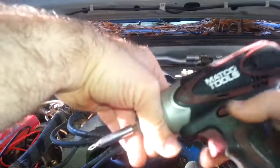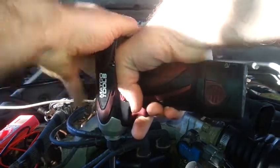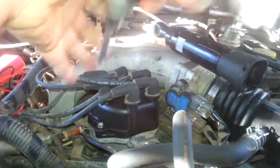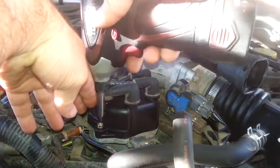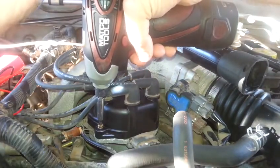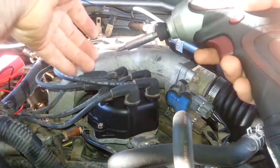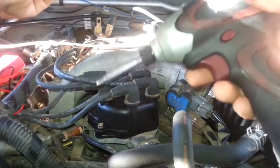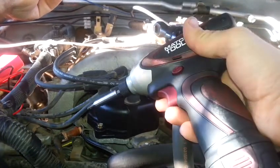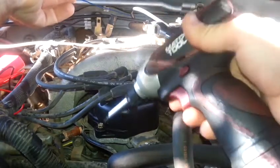That's got a simple switch back and forth. For example, if I hadn't already changed my distributor cap out, I could make a little adjustment and quickly and easily destroy screws with this. This is very powerful. Put a little pressure on it — or a lot — and I'm destroying it. I generally avoid using screws as much as possible if there's a bolt. I find it to be very powerful, and that is a problem. So whenever I'm going after a screw with this, it's worthwhile to start it with a screwdriver first, if you don't want to twist it out like I just did.